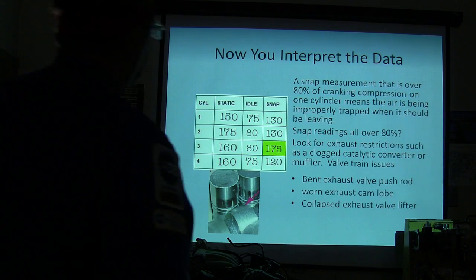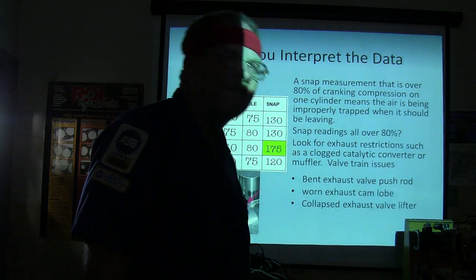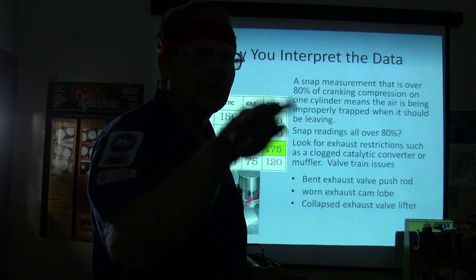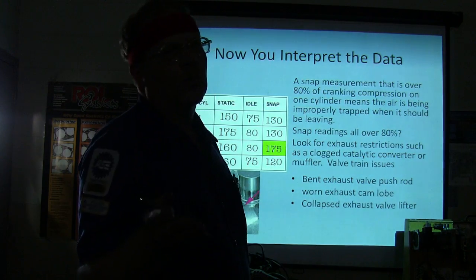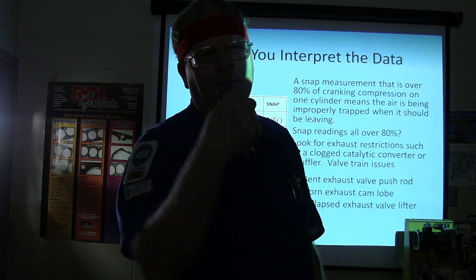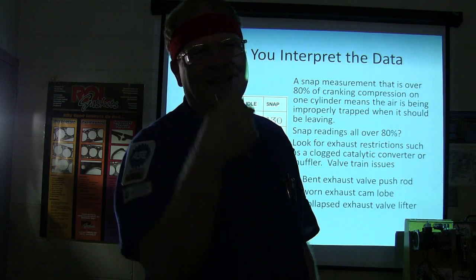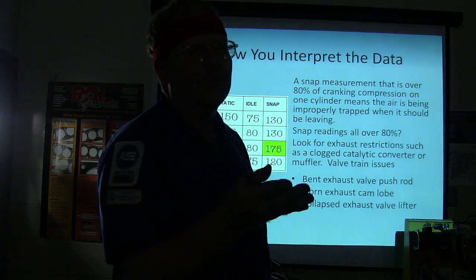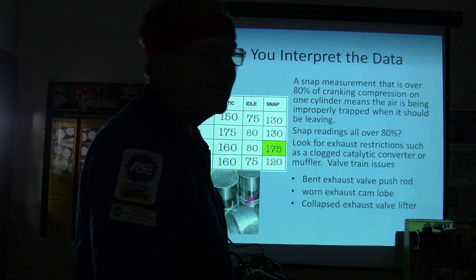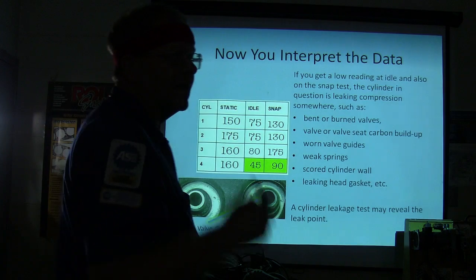We should have done that on a Jeep. Yes, we could have done it on the Jeep. That guy's all about hot rodding that Jeep anyway. He wants to tweak it and make it better, that's all he studies. And furthermore, the way we were doing it, if you put the dial indicator on top of the spring when the push rod is also mashing the spring, you could have a lifter that's squishing. But at the same time, if you're going to replace the lifters on one that old, you'll usually find camshaft issues, especially because it doesn't have roller lifters in it. I don't believe that one just got flat. So what is that doing on fix it? Yeah, he's going to bring it back next semester.